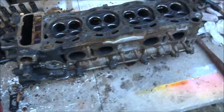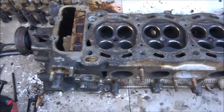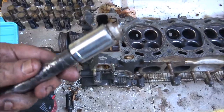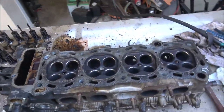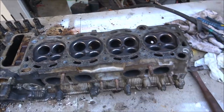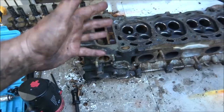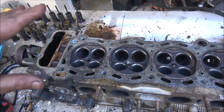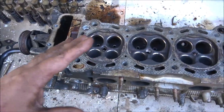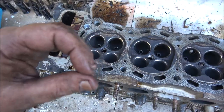So I thought, since we had the Chevy now, sooner or later this was going to have to be done. Once you got it up to higher speeds, like 60, 70 miles an hour, that cylinder would pick up, that plug would start firing apparently, and it would run fine down the highway. But taking off, it was real jerky and idling. When I would pull the coil off and on, it wouldn't do anything. These were all firing, this one wasn't.